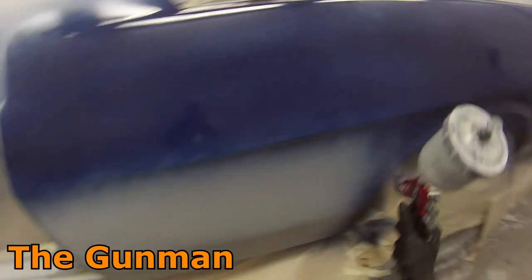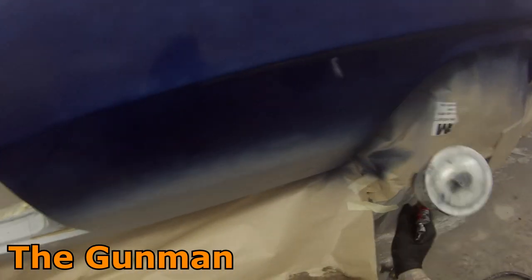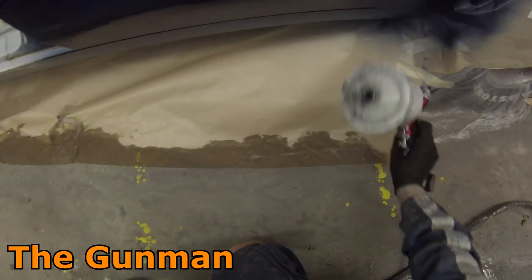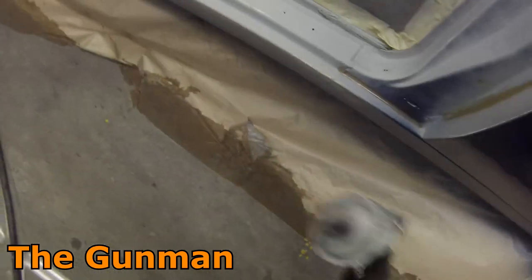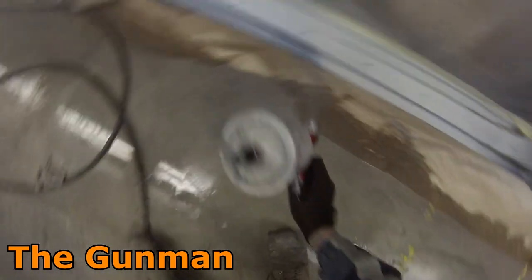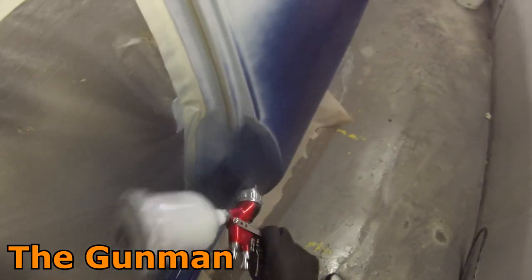This was basically paint just sitting up on the shelf not getting used. It hadn't passed its use-by date or anything — you've got a decent lifespan on base coats, you'd easily get 10 years out of a can of base coat as long as the lid's been kept on and it hasn't started drying up. I've seen people use base coat from 20-plus years ago — as long as you can still stir it up and it hasn't turned lumpy and won't come through your paint strainer, it should be right to use.